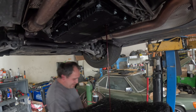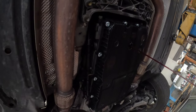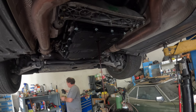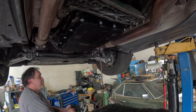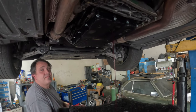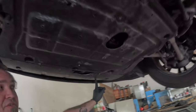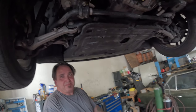Now, three hours later — we are completely going to be draining this out and we will refill it with SP4 RR Ravenol, and then we'll put the trans cooler in. Because we don't want to mix the SP3 with the SP4 — you don't want to mix transmission fluid, it's going to be bad. So drain it first, and to do that, we're also going to be removing these two panels so that we can get the transmission cooler lines, which are up underneath this front panel here.